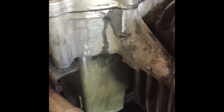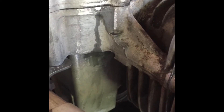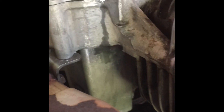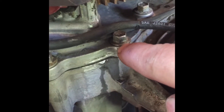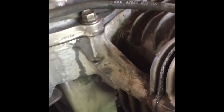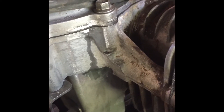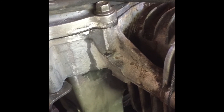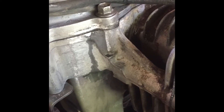After a test you can see it's still leaking a little bit of oil through it — not like it was, not squirting out, just barely anything getting wet. I also noticed this top bolt right here I had to tighten down a little because it was coming from the gasket. I think I'm gonna let it cure a little more, then clean it up and put another coat on it. I may have sanded too much down and made it weak.